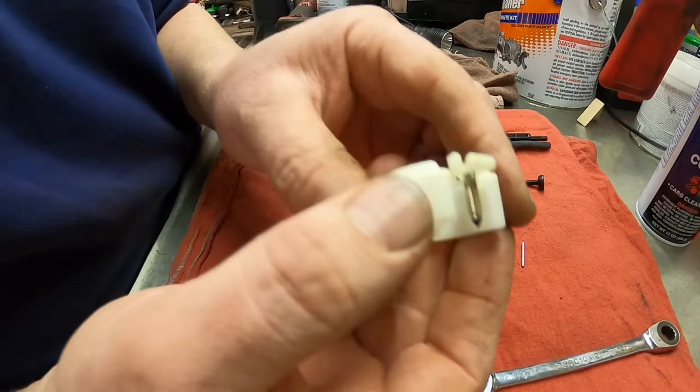I had to put the machine outside because I had some other work to do. Let me go get the machine and we'll start putting the carburetor back on. All right, I got the machine back in. We'll start putting it back together. First thing I'm gonna do, I'm gonna take this hose off because it's kind of getting in my way and driving me crazy. Since we didn't rip this gasket, it's still in good shape, so we're gonna reuse it. So on here, we're going to start to slide the carburetor back in. And can you see the linkage piece? You really can't see. Let me pull the camera up so I can lift this up. Gotta slide it in a little bit farther.